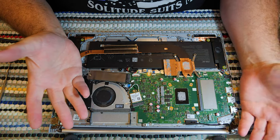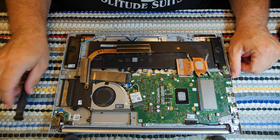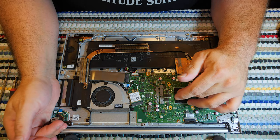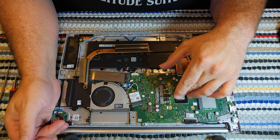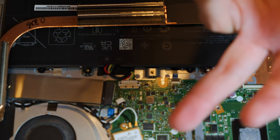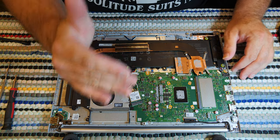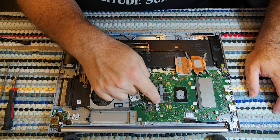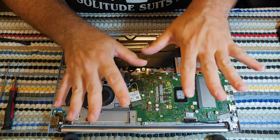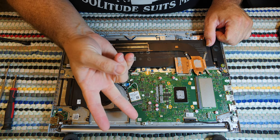Okay, you can't see my face, but this stuff is baked. I don't understand how I almost cursed. I'm trying to keep this video from being throttled, but okay, see this? Look what I'm doing. See that? All right. Now, how much of it do you see on my finger? There's none. This stuff is baked. How is this computer not even a year old and all of this heatsink goop everywhere is baked on? This has to be removed. I'm going to go and get a paper towel and some heatsink paste, and I'll be right back.